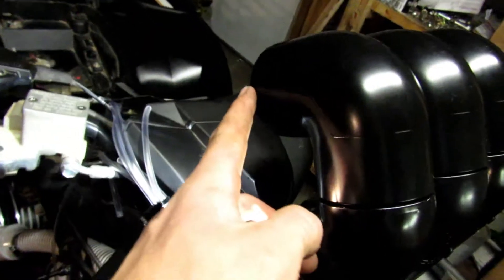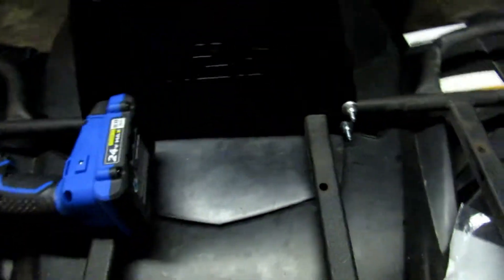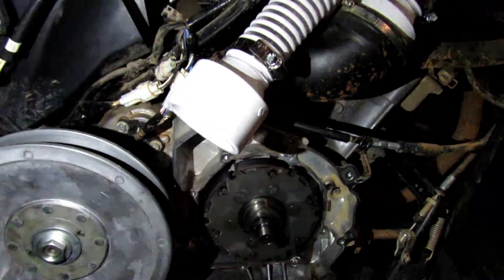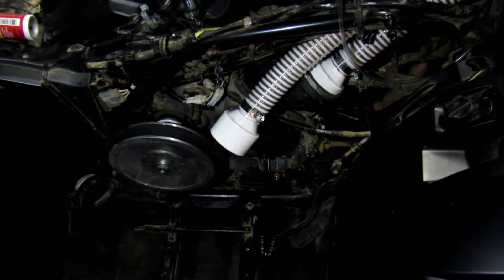Alright, update video. You can see all the vent lines — I've got to figure out what I'm going to do with them, but I've got all the risers in. This kit comes with bolts so you can line them all up. Just make sure your end snorkel doesn't have a hole in it and this side doesn't either. The middle one's got to have two holes on both sides so the bolts go through and connect. Your bracket down here is very nice — it's got a little U-hook on it. The couplings for your intake are going to be the full couplings; the others are reducers because they have that little 90-degree piece that goes up in there. Still waiting to get my clutch back together for that gasket, so this one's just going to dangle for now.